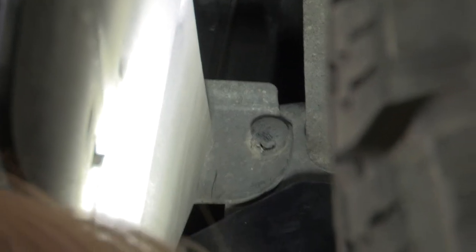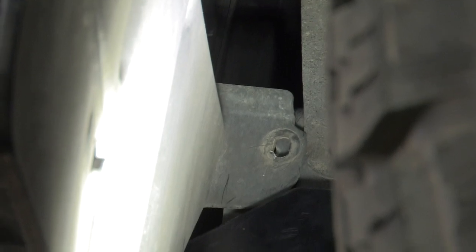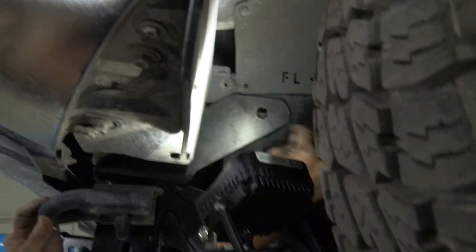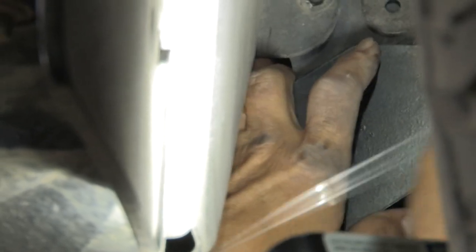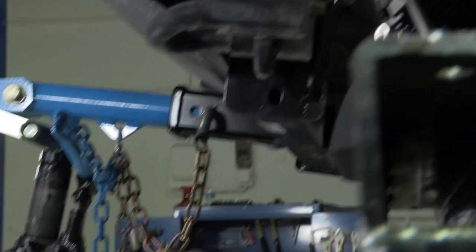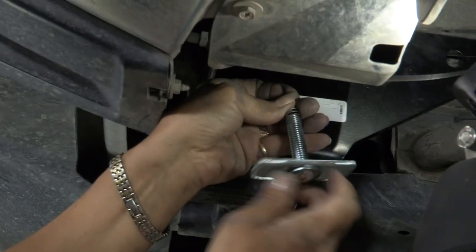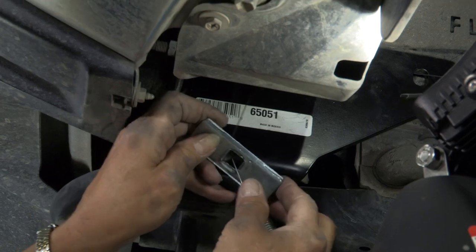You've got to feed your line through the hole, moving the plastic out of the way. Go ahead and feed the line — you have to push it through. Put your hand up in here, catch it on the other side, and bring it down. Then put your bolt on and screw it on as if it was going right up into a nut. Make sure it's all the way to the end because you're going to be pulling on it and you don't want it to come unhooked.